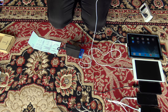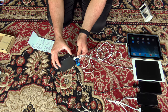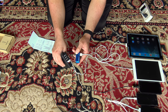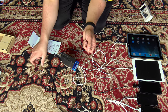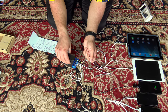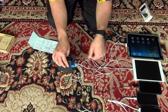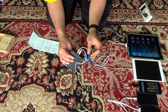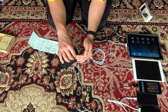The iPad Mini is flat dead, so let's see what it draws: 1.8 amps on the standard port and 1 amp on the Quick Charge port. Moving on to the iPhone 6s at 50% charge — it is drawing 1.4 amps, dropping to about 1 amp at rest, and going back up to 1.3 amps with the screen on. On the Quick Charge port the iPhone 6s draws 1 amp.